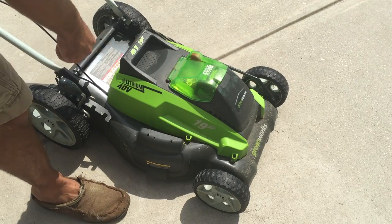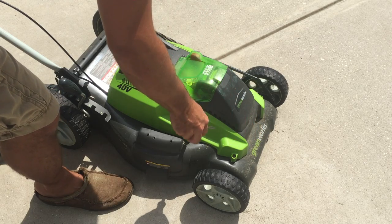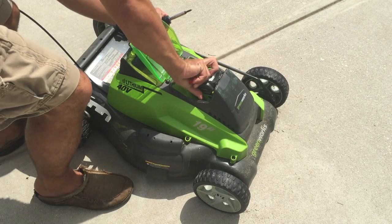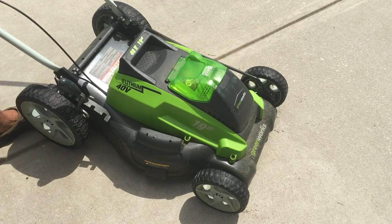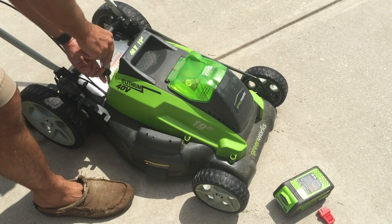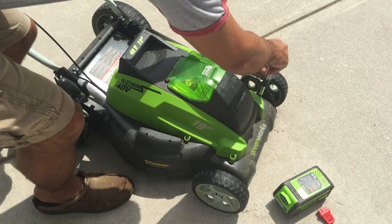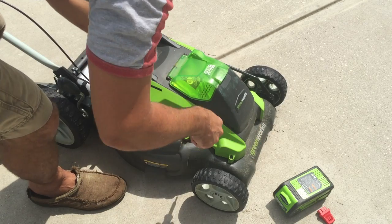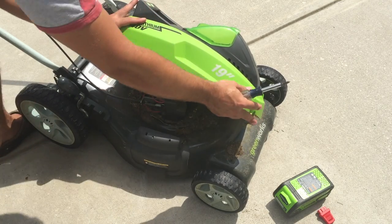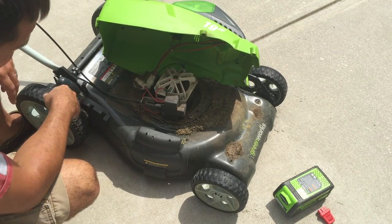There's only 6 screws on top, so all you have to do is remove those. Oh, before you do that, take out the key and the battery. Now, lift off the cover. All you have to do is prop that up and don't unplug them, and that's basically the wires for the battery and the key.